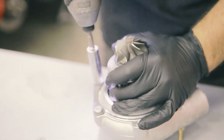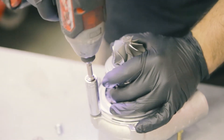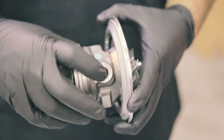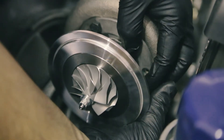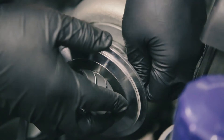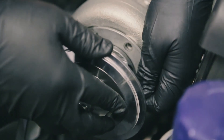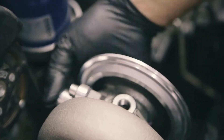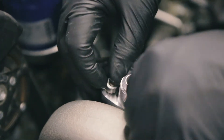Back to the turbo — now we're taking off the rest of the bolts to remove the other housing. Then we're taking just the turbo and putting that onto the car. Once again, we're just tightening it enough to keep it in place, but loose enough so that we're able to still rotate the base. Now we're putting on the oil return flange, and once that's tight, we turn it so that it's facing downwards. This one you can go ahead and tighten all the way.